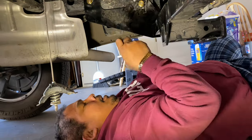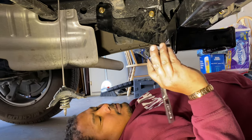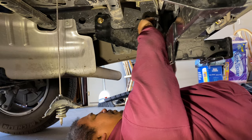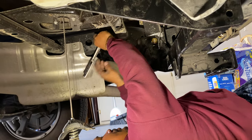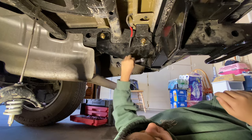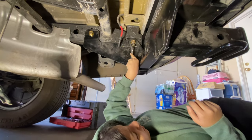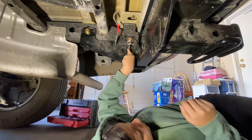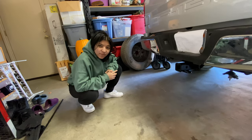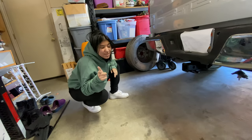Now we've got to tighten those up. We're supposed to torque these at 210 — we'll have to go get a torque wrench, but in the meanwhile we're going to tighten it up with a 15/16 socket. Feed this one in first before you start tightening, that way you don't have any issues. This is the ground bolt, so be sure to tighten this too. After you've gotten done tightening everything down, you're going to put the spare tire back on the truck for the last step. And after that, happy towing! If you like this video, comment down below and comment on other things you should do. Be sure to smash the like button and subscribe. Toodles.